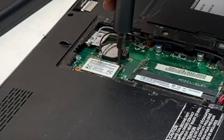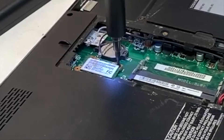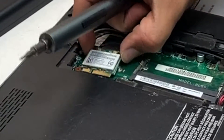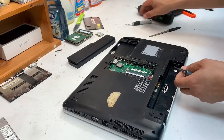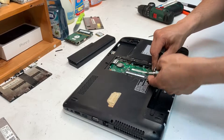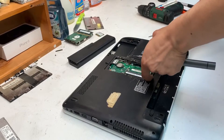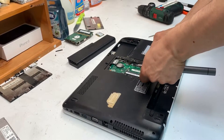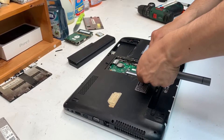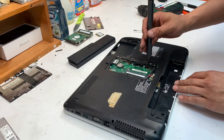That's your Wi-Fi, held by one screw. Unscrew that and just lift it at a 45-degree angle. This is your DC jack connector. Simply lift it up — don't hold it by the cable and lift, because that will probably snap it. Unless it's already damaged, that's a different story. Just wiggle it from side to side until it comes off.